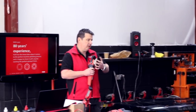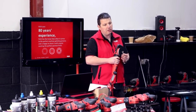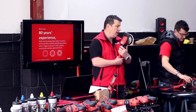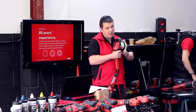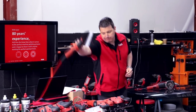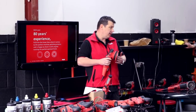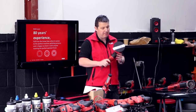The PE14 Mark II has been our best-selling rotary polisher for quite a few years, and the XE has been our best-selling DA polisher for quite a few years — until about two years ago when we introduced the XFE. The XFE is what we call a free-spinning polisher. We've got these in three sizes: 150mm, 125mm, and 80mm. It's probably equivalent to another brand on the market that has a free-spinning polisher with about the same 15mm throw — not mentioning any names.